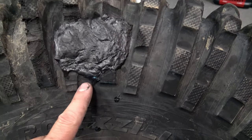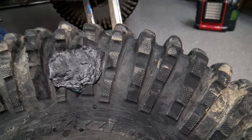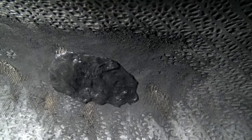So this is what I got on the outside — kind of mashed in and it's still soft. Let me show you what it looks like on the inside. You can tell I cleaned it up really well all the way around. Now I've got to let this cure. It says about 48 hours, but it all depends on temperature. I had the heat on in the garage — they say you want it to be above 70 degrees, so you don't want to do this in a cold garage. Summertime is probably better. I'm going to put a heat lamp on the tire and let it cure for a few days. I'll come down, do some checks, poke around and see what it feels like, then we'll mount it up.